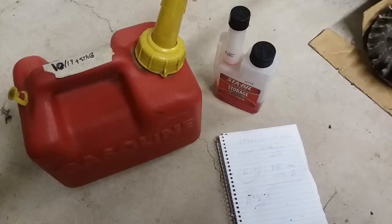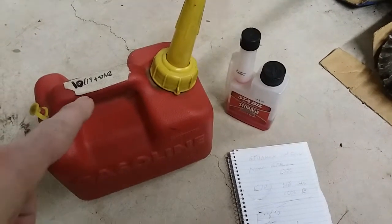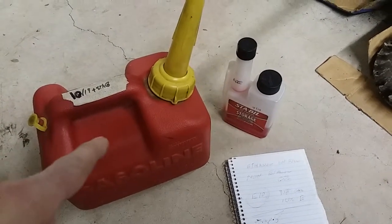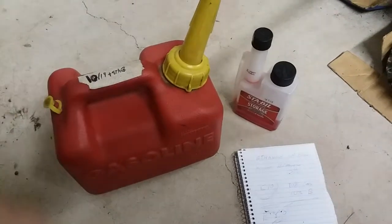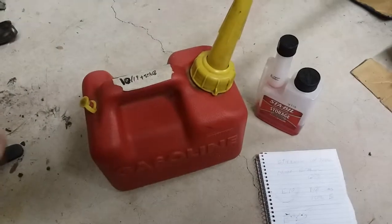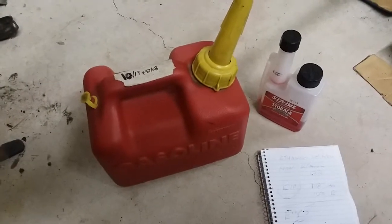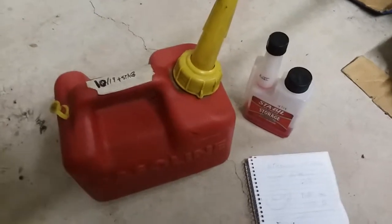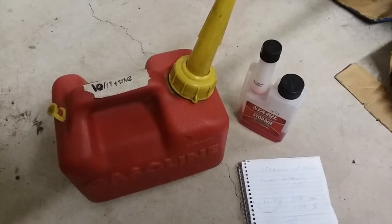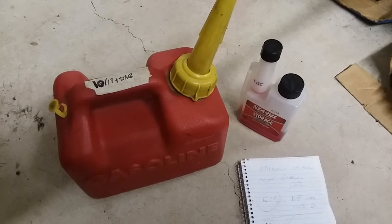So that's just what I wanted to put out there. There were a couple of questions about using this fuel. Just try to do good housekeeping and don't leave fuel sitting around for more than 30 days. With stabilizer, maybe 60 days — I've gone to 90 on some rare occasions — but that's about it. Just follow that and you should be good. Thanks.